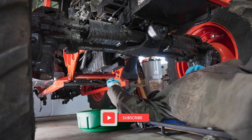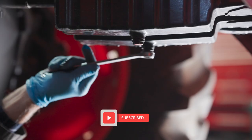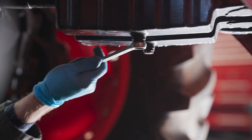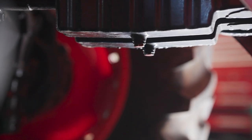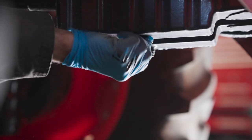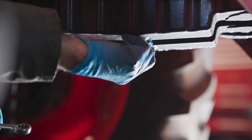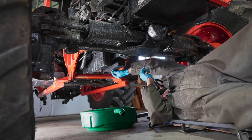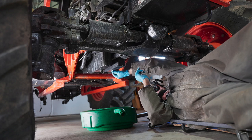To replace the oil we have to open, take those two plugs out and drain the oil into a pan. While you're doing this you should be wearing gloves because oil is contaminated.